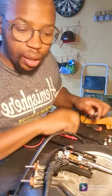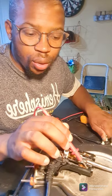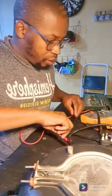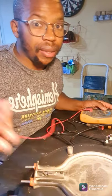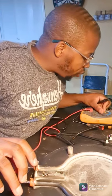Now let's check the neutral line. I'm going to go to neutral on the plug and go to the neutral outlet — there is no power going to the element. Let's open this further and check if there is a problem with the neutral line. But first let's check the element quickly. You can use continuity or you can go to resistance — you should have a certain resistance on the element.